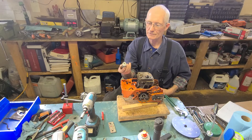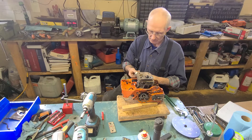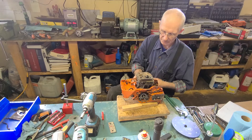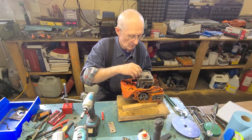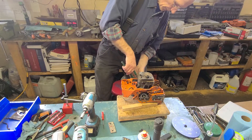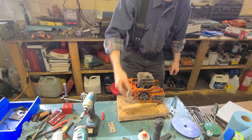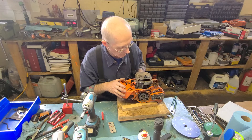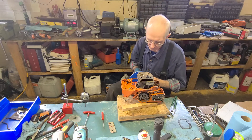There it is — these are flywheel adapters that I make, drilled and tapped for different size cranks, threads, and pitches. I just turn it on there and spin it until it butts up against the flywheel. Then I put a piston stop in, turn the flywheel backwards until the piston hits the piston stop, and tighten down my degree wheel adapter until it's really snug. Take out my piston stop — that's pretty close to top dead center. Then I spin the degree wheel on to the degree wheel adapter.